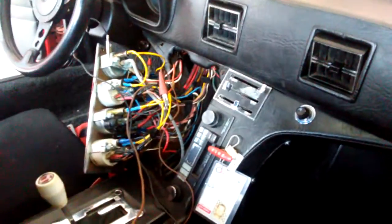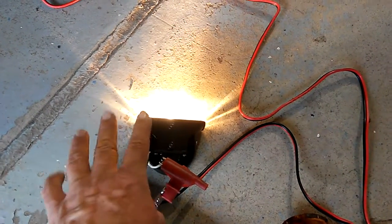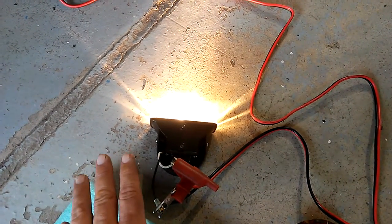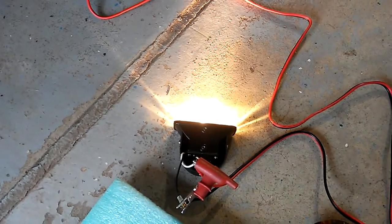For any type of short you can find, you can actually pigtail off there. I unplugged the wire and I put an alligator clip on to it. I've got the cords coming over and I am using a light as a load. When this is not shorted, it barely glows orange, and this is my load to keep from burning up any wires in the vehicle.